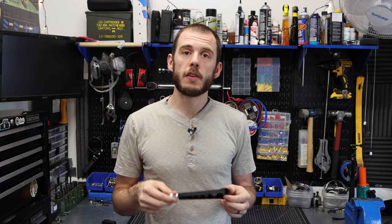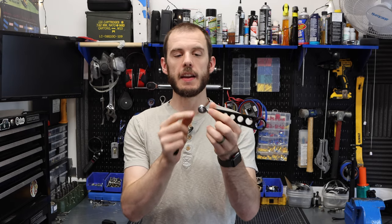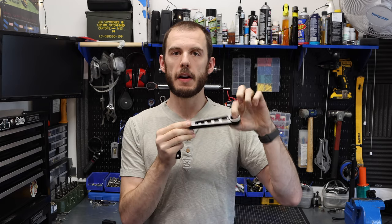Today's episode is a quick one and a pretty simple one. We are going to be replacing the engine steady that's on my car, which currently is a nice adjustable engine steady, with something that has a fixed rose joint mounting on one side and a spot for a normal bushing on the side that mounts to the bulkhead. On my last episode about the charge cooler setup, I had quite a bit of engine movement when I was accelerating and shifting gears.